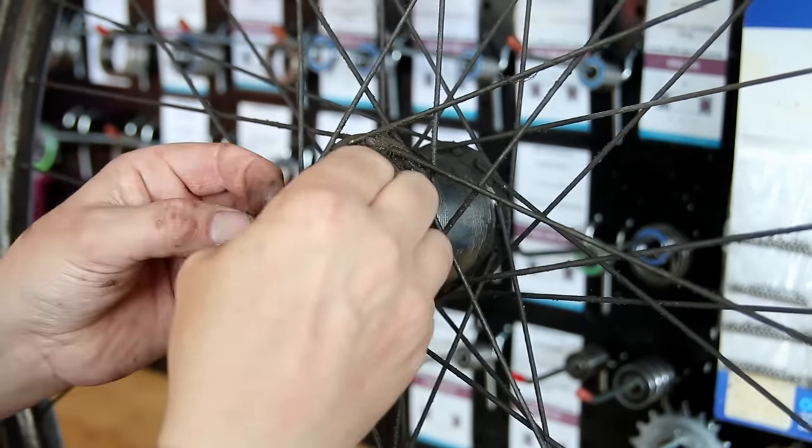Using our premium grease with a syringe applicator, new bearings go in — looking really nice. I use a pair of tweezers for the bearings, which is the least fiddly way to do it, then put some premium grease over the top to stop anything falling and hold them against gravity when putting everything back together. Some general purpose grease on the threads helps the cups and cones go back on. The cup and lock nut go back on — absolutely perfect.